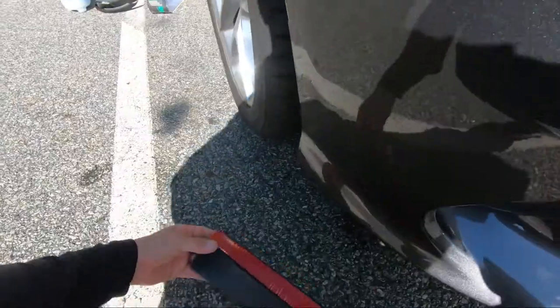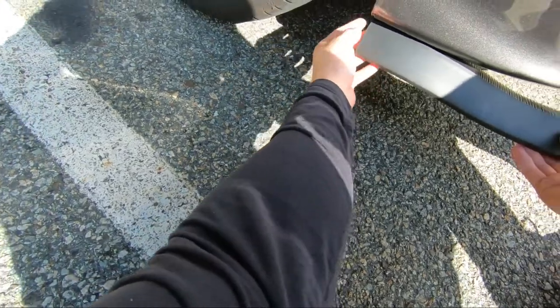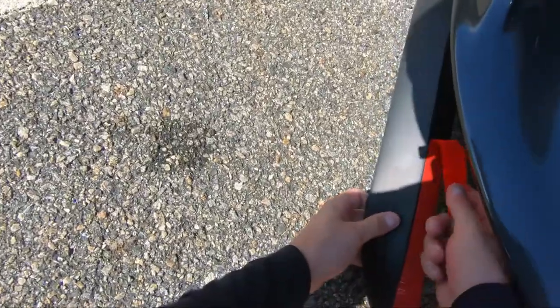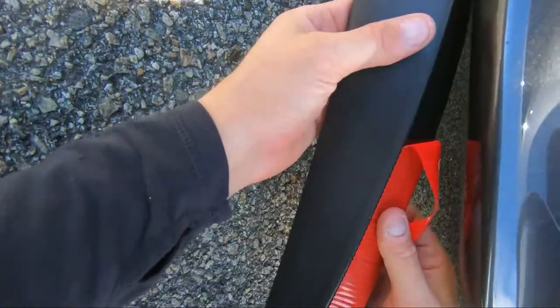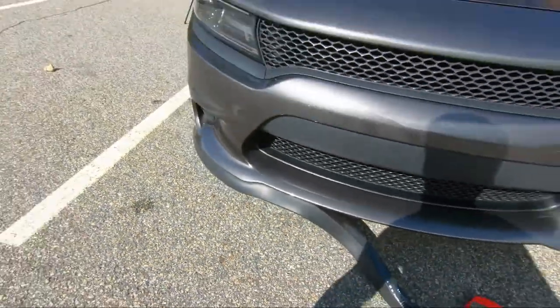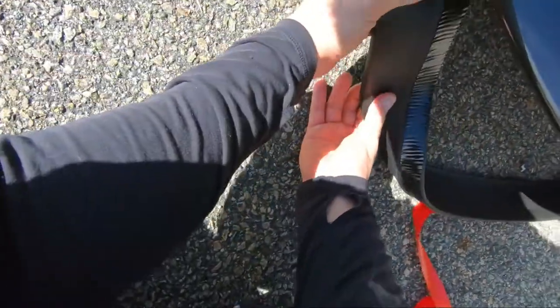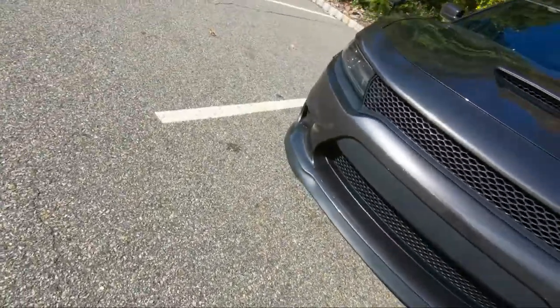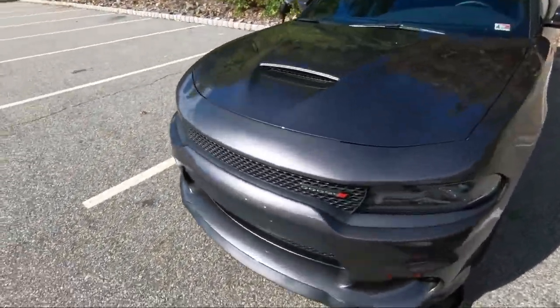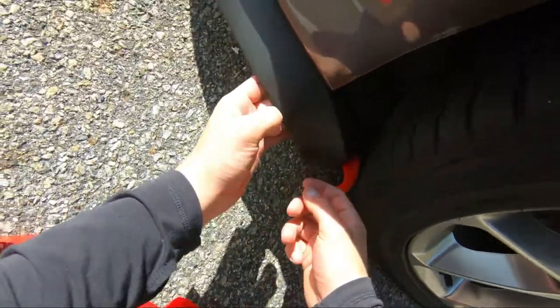Done — time to stick on the Easy Lip Pro. Now we're going to start sticking it on. Before we do, make sure you line it up and have an idea of where you want it. Take your time — there's no point in rushing. Make sure that every single time you stick it, you're not applying full pressure — just give it a little bit, just enough where it sticks, and then gradually make your way around the vehicle. Notice how I'm not pulling the red plastic backing all the way back because I don't want any debris getting on the adhesive tape. Stay patient, do a nice walk around the car to make sure you're liking it, then continue the same process all the way around to the other side, applying very light pressure until the very end.